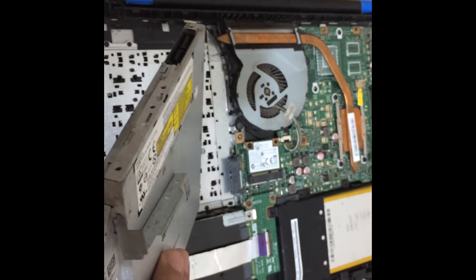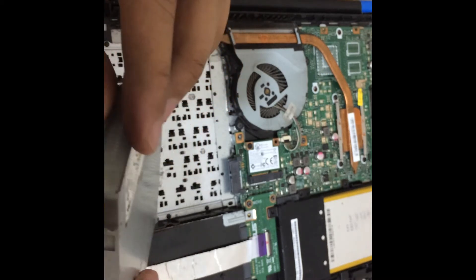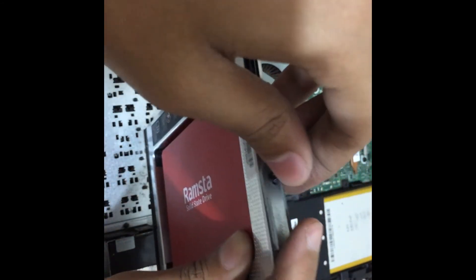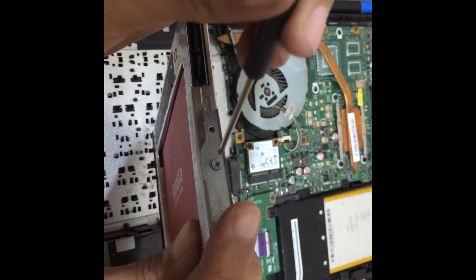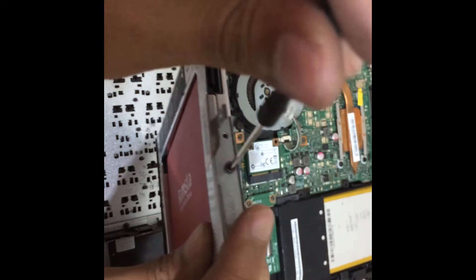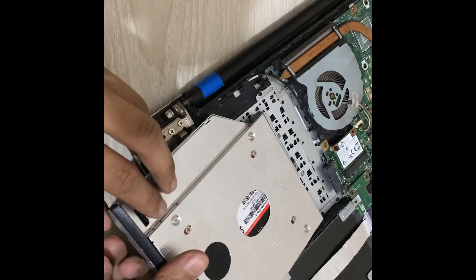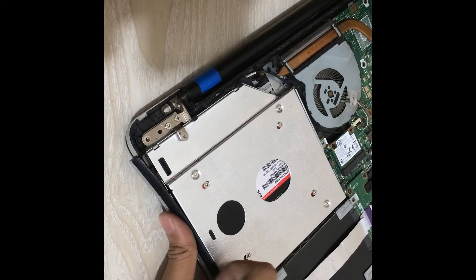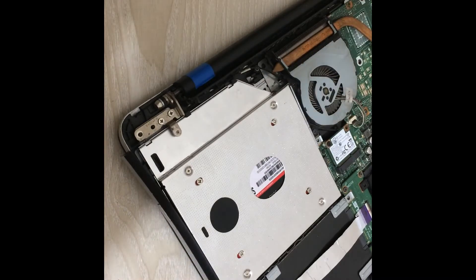I have removed it from my CD-ROM. You don't need the CD-ROM anymore, so put it aside. Now let's attach the extra metal portion to our SSD Caddy — we need to screw it on. Make sure you have inserted your SSD properly and screwed it into your caddy, then insert the caddy into your laptop and screw it properly into your laptop's motherboard slot.